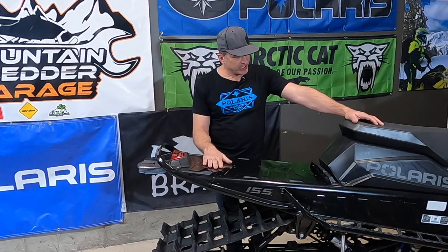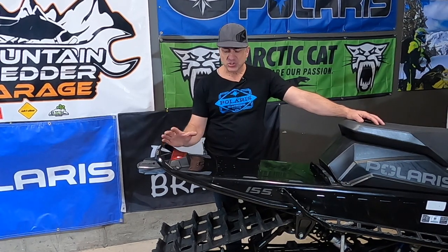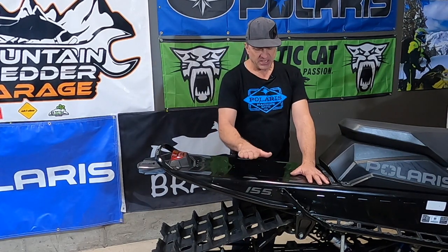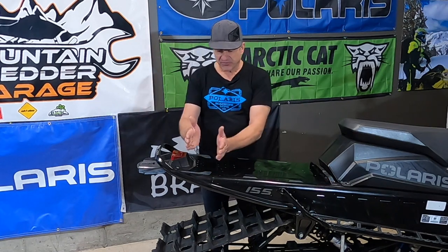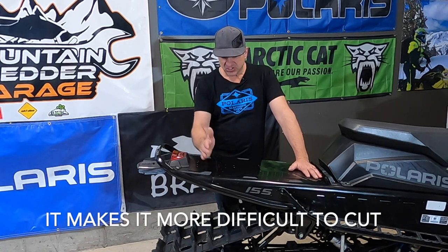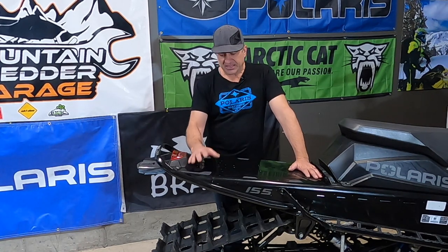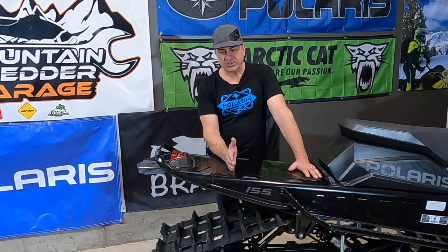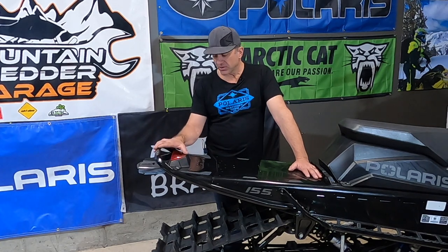This sled is going to be my mod sled for this year — it's a 155-850 Matrix slash. I've been looking at how to shorten this for over a year. I really wanted to be able to shorten it without cutting into the tunnel piece because this piece is really expensive. It's easier if you can cut the back part that's replaceable — the extension. I don't feel a good way of cutting just the extension and leaving the tunnel in place that looks clean. So I'm going to cut a couple inches at first to see how I like it before I commit. I think a two or three inch cut on the slash is probably about where you need.